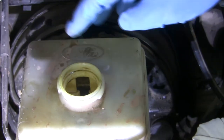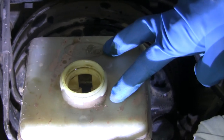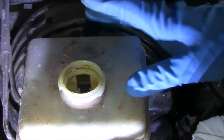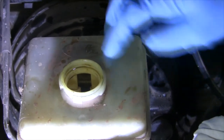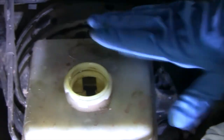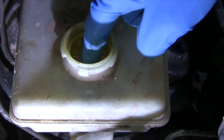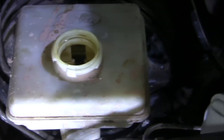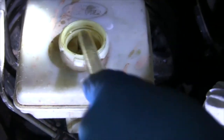The 1999 Discovery 2 is equipped with a two-zone anti-lock brake system. The purpose of the two zones is that if any one zone gets a leak, you'll have reduced braking but it won't fail your entire brake system. You can see the zone by this little dam right here. The back section is almost full of fluid while the front side is actually empty. Make sure when you're sucking out the fluid that you get into that back zone and suck out that stuff.